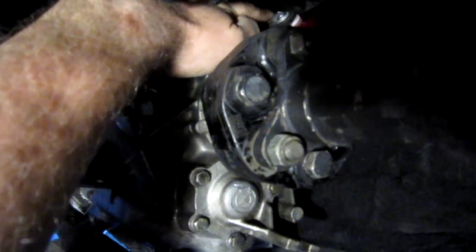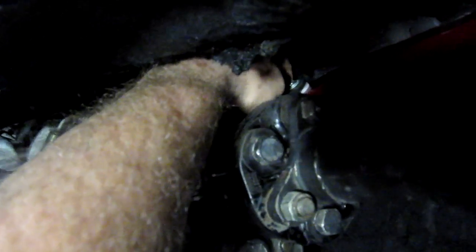So, this front bushing up here, I got the new stuff in here already. This clip up here flips up, goes up like this and then out. So you want to get something up here to pry this up. On the back side of it, there is a little tab that locks in, so it's pretty tricky to get up in there. You just want to get a bunch of different screwdrivers and whatnot till you find something that can get up there and pry the front of that clip up. It'll swing up, and then you can pull it straight out.